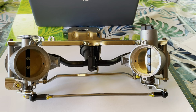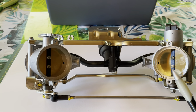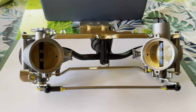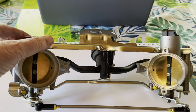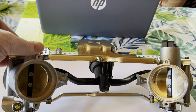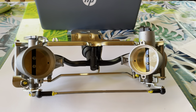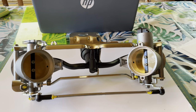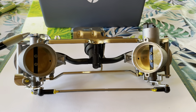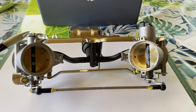To start off with, let's just get a general overview of what we're looking at. Obviously, these two items here are the actual throttle bodies themselves. When the throttle is opened, it moves this cam plate here and you can see the throttle butterflies move and open to allow more air into the engine. We are at the moment looking in from the back of the throttle bodies, from the left hand side, where the cables come in at the top to operate the butterflies.